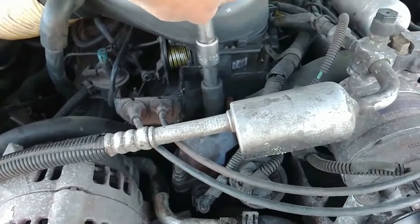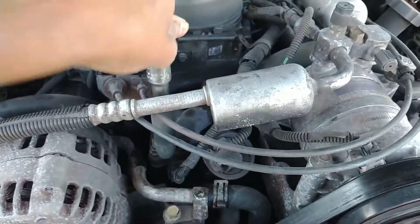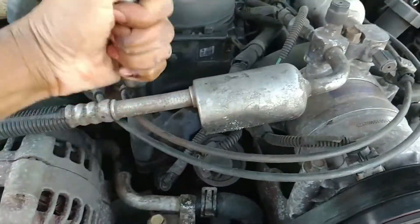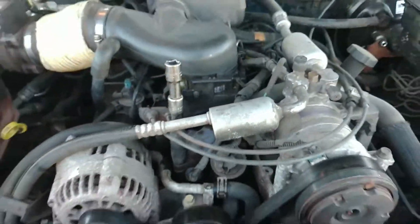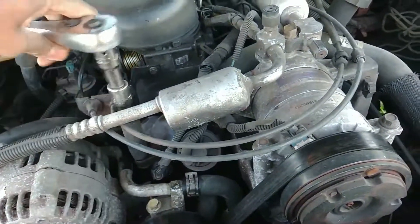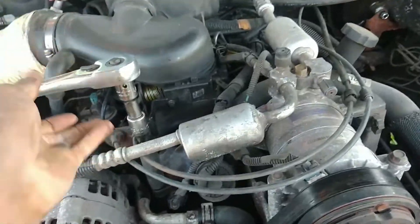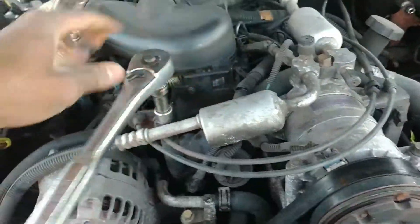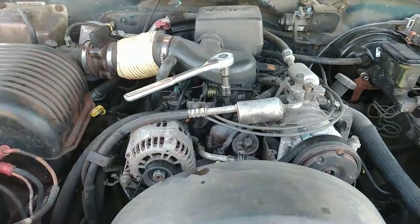Go ahead and tighten these up. This has been a quick video brought to you by three wheels in a block. My name is Erwin — thank you guys for watching. If you're having heat issues with your Chevrolet truck, Chevy Suburban, Tahoe, or GMC equivalent, check your thermostat. The engine temperature on this thing was roughly around 120 degrees all the time, never got warmer. My thought was no thermostat; turns out it was stuck open. That easy. We'll see you soon.